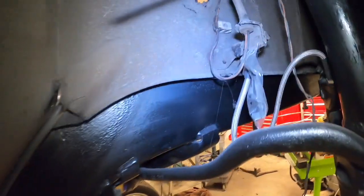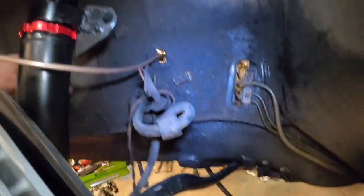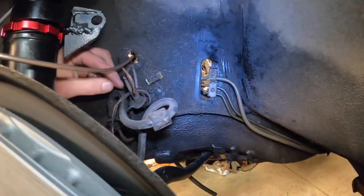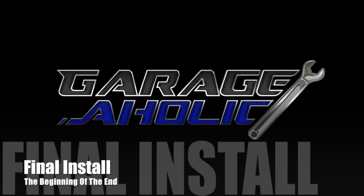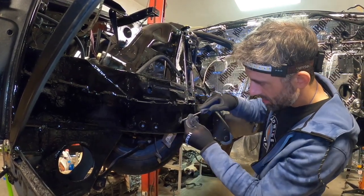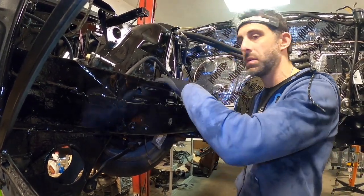And coming out of the wheel wells, you'll see right here on the passenger side, we have to terminate that to the stainless steel brake line that you see right there. And on the driver's side is the same story, but this is a lot longer. We're going to need to trim that down and terminate it over to this stainless steel brake line. Factory locations, we're going to need to clean this up significantly, so we'll do that as well. Body ground, uber clean before we install because it won't be the easiest to get access to and clean later.